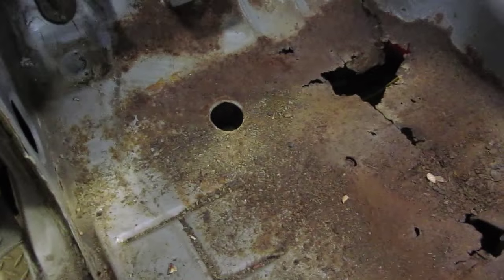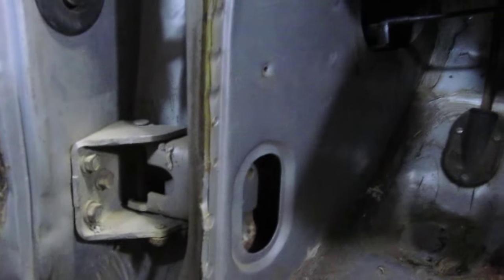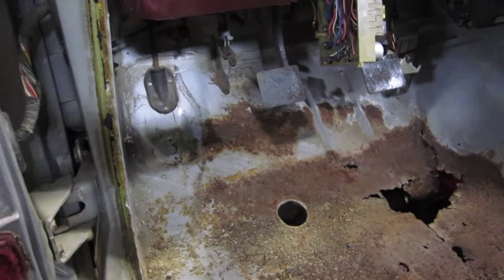The floor is in excellent shape except where the driver's foot was — that's the biggest issue. We got a patch panel but it comes from a regular cab, and the back of it goes up here, so I'm gonna cut this piece off at the back. You can see it's welded flush right across. We're trying to make this look as original as possible — we'll weld it to the side here, the little lip goes up on the side, then we'll seam seal it and connect it all the way along the tunnel. We could overlap it, but I don't really like to do that because it's one more spot for moisture to sit.